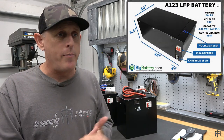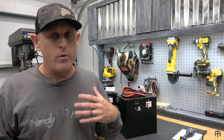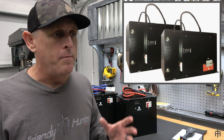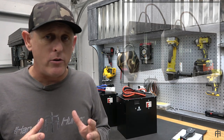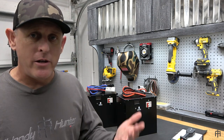The second option I looked at were the A123 batteries - great reputation and reviews on those packs. They may require a little bit of battery tray modification, nothing too difficult, just to fit in your cart. The third option I thought I would land on is used Nissan Leaf batteries. BigBattery.com takes used Nissan Leaf battery packs off the market, matches them up nicely, puts them in a metal case with a BMS system and a handle, and you can literally drop it in your cart, plug the cables in, and be ready to roll. They're the most economical option and would still have years of life left.